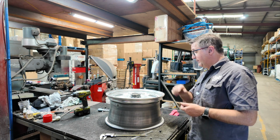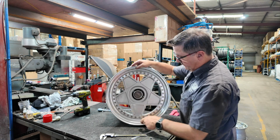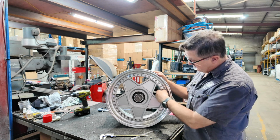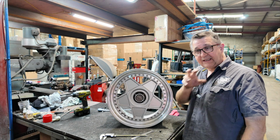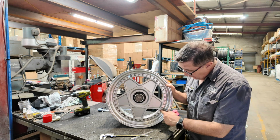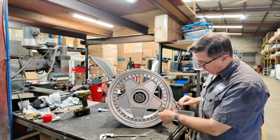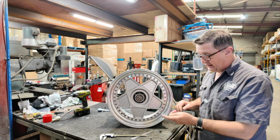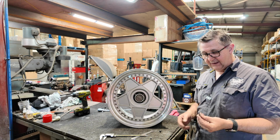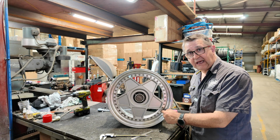Okay. The other thing, again, about these, I'm not going to go and pull everything out. That is not a spigot there. It's a different size. So the end where you can rattle the centre around in that. And again, your bolt is pulling down on a void. And again, this spigot, or this tang on the wheel itself is not parallel. It's like that. So anything you bolt down that is, well, you can't use these bolts for a start. These ones are quite a bit deeper. This is about 1.5 millimeters deep.